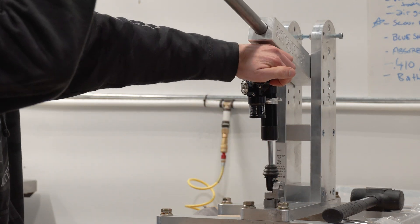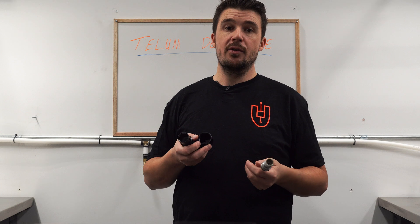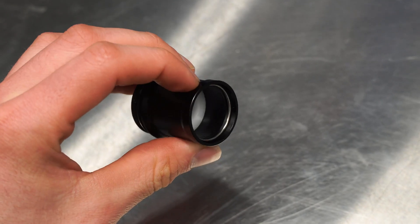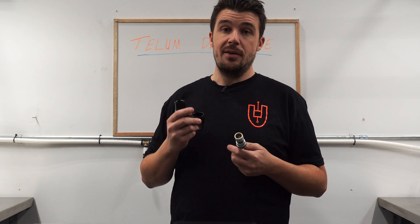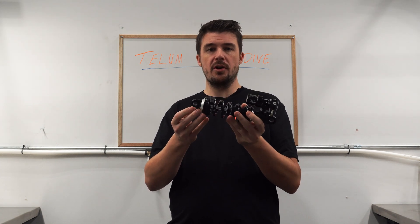That degree of friction is so tiny as to be well below the threshold of what people notice or what matters. Does that mean bladders are bad or silly? Absolutely not — they're cheaper to make than IFPs, which is good, and if you have a larger shaft diameter then eliminating IFP friction starts to make more sense. They just aren't the best choice for this specific application.